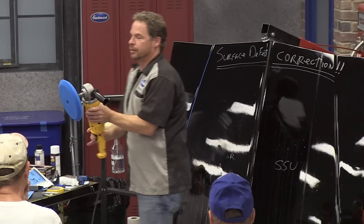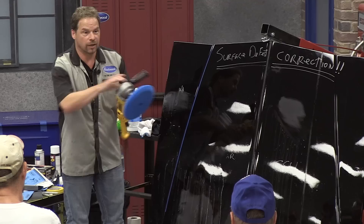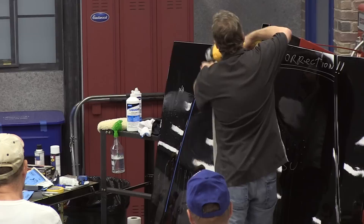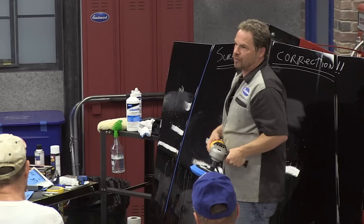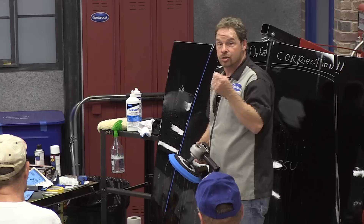This is not a reversible buffer — it's going in a clockwise motion. If I'm buffing toward a style line, I'm cutting into it — not good. I flip my buffer and all of a sudden I'm buffing off of that style line. Same thing with edges of the hood — just move your equipment around, change your body position. Now I'm buffing off of the panel instead of onto it. It's very simple but sometimes we forget. If it's a tight spot like a transition from the sail panel into the top of the quarter, it's hard to find that position, but it's very important to step back and figure out your equipment — which direction it rotates and where you can place it.